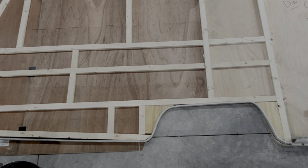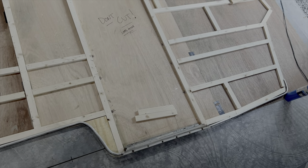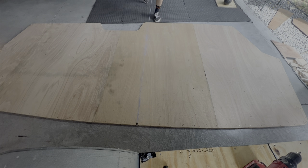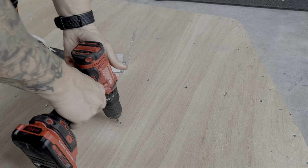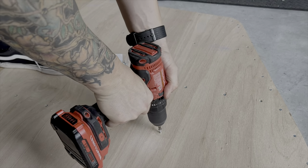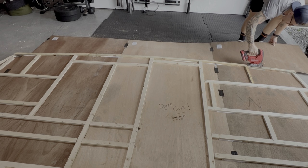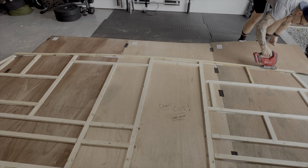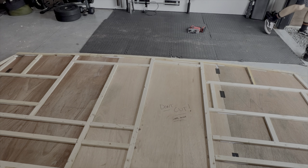From there, I took 3/4 inch nails and glue with the 1x2, and I framed out everything I needed on that sidewall. I gently flipped it over and ran chalk lines along all of the longest supports, and then added screws about every 5 inches or so. Surprisingly, this made it a lot less flimsy, and you were able to use the jigsaw and cut out your shape. And with that, we had one wall basically complete.